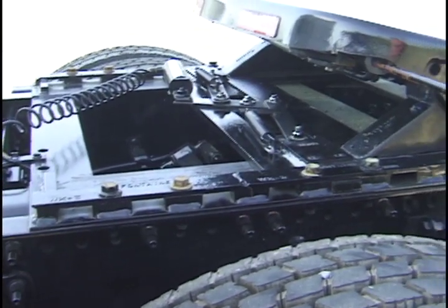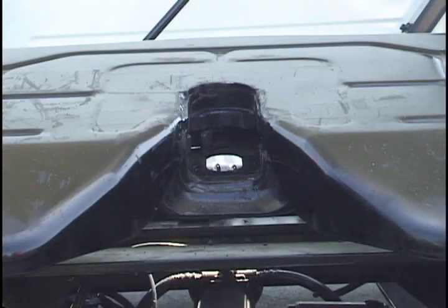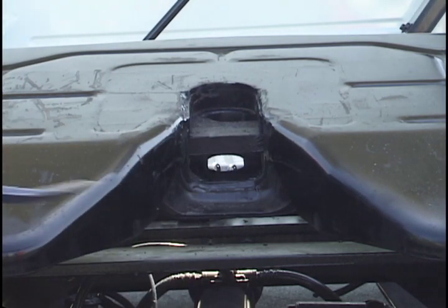Begin the visual inspection by cleaning the fifth wheel. To degrease properly, the lock should be in the closed position. To close the lock, push the bumper off its seat with a pry bar. This provides cleaning access to the jaw and wedge.